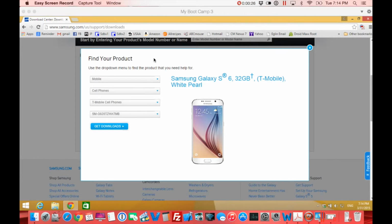The program's called Odin. So this link will be in the description, and you need to go to your settings on your phone, and then you go to About device, and then you go to the model number. I have the T-Mobile Samsung Galaxy S6, so my model number is SM-G920T, which is right here, and then everything after that is basically color. So you just find your color. I don't think it matters, but I found my color and my storage size, and so now I'm gonna hit Get Download.